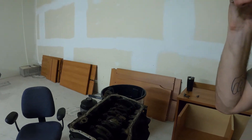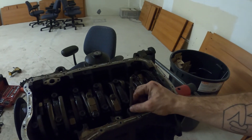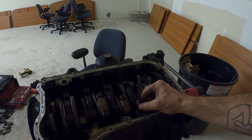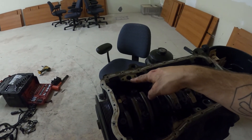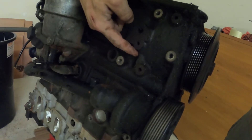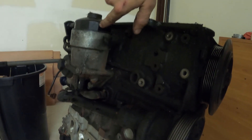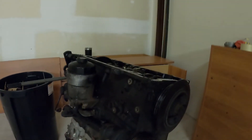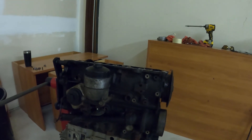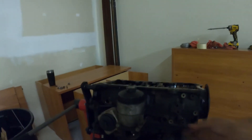I've got to plug the hole this shaft sat in — that's what spun and drove the oil pump. This is the stock oil pressure inlet — it goes up into this galley right here, then goes over into the oil filter, and then back through the oil filter to feed the rest of the engine. Pretty straightforward stuff. This whole oil filter housing is going to disappear completely, and I'll have a line running out of the block right there.